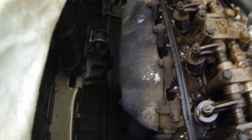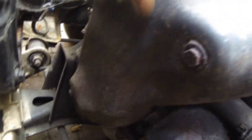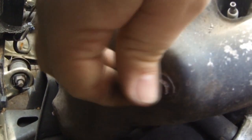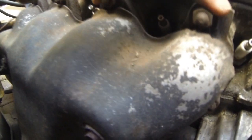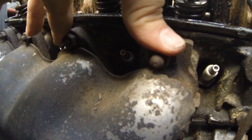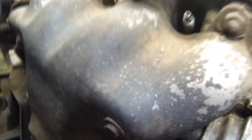I'm just going to carry on now and strip everything else out. I know I'm going to have a problem with these three bolts down here - there's one there, one the other side, and one at the bottom. When I started to undo these they started to round off, so I'll probably have to lose them anyway. I'm going to have to take the exhaust manifold off and redrill that out. This was the reason why I didn't do it last time, and yes, it's come back to bite me in the backside.